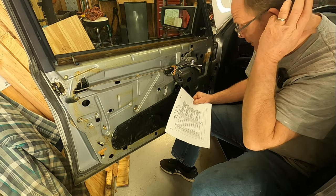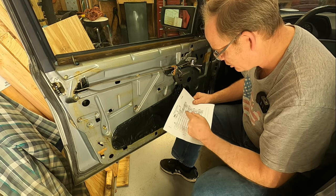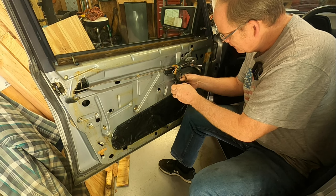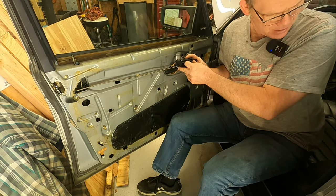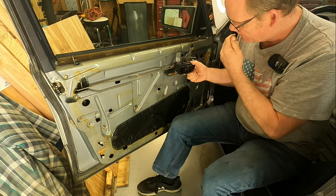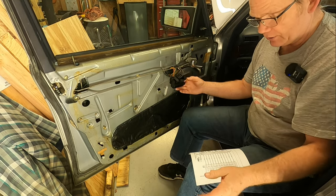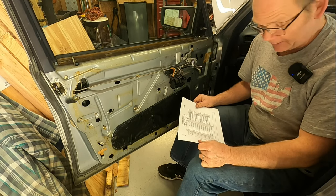So what I did was swap the gray and orange wires on the backrest - they're just power wires. I'm going to plug this thing back in and see if I can get the backrest to go forward. I move it that way and it goes back - still goes back. I get it now: I'm trying to move it forward, but I made it move back because I swapped the wire. That was stupid. However, it does prove that the switch is 100% working because I was able to activate the switch and it actually moved the seat. So I need to put power to the right spot to get this seat back to move forward, because right now I'm laying down there ready to take a nap.